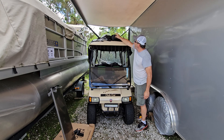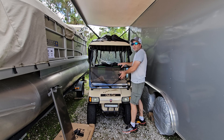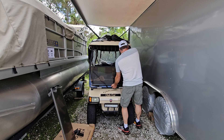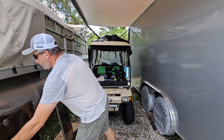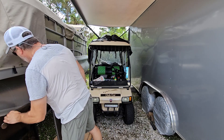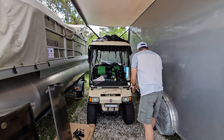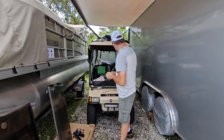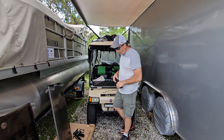We have the last rubber bracket drilled off - they were riveted on. Now all we've got to do is lift up on the old windshield until it comes out of the bottom bracket, then release it from the sides. We got the old one out. I have to say the older one is thicker and feels heavier - it's definitely a thicker windshield. These are the brackets that just slipped on and the windshield clipped in, so we got those off.